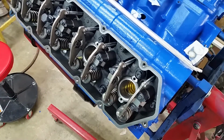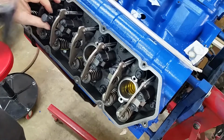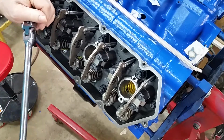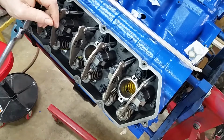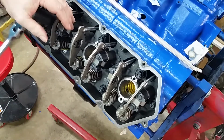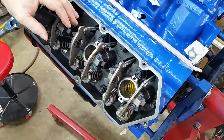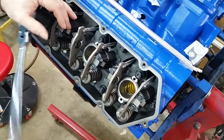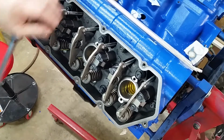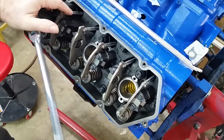See if that'll get it. Tell you what, that Loctite gets a grip. It don't want to let go, that's for sure. Sweet. Doing its job, that's for sure. And I did find out that if you find uncured Loctite in the bore when you pull these, it's because it's an anaerobic glue. Doesn't dry in the presence of oxygen, only lack of oxygen. And you can tell that because you have to use a wire brush to get it out. So it's doing a good job sealing.